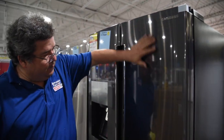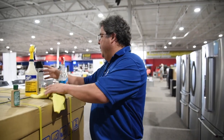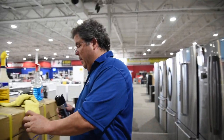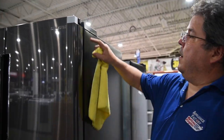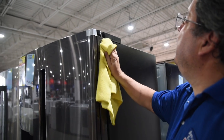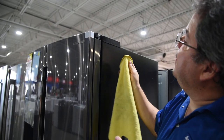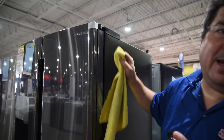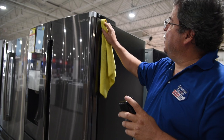This is actually black stainless. We're not using Comet or anything like that which has any grit to it. The best thing to use is a stainless steel cleaner of your choice. To find out if you like the stainless steel cleaner, first find a very inconspicuous spot. Put just a little bit on and rub with the grain. Rub it and see if you like the way it looks — is it nice, is it clean, does it leave a residue? Obviously check that it doesn't damage the stainless — that's why you don't just blow it on everywhere.